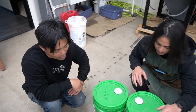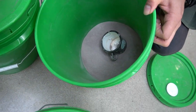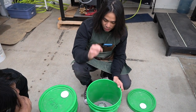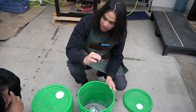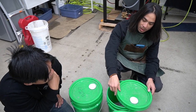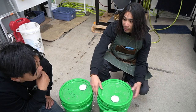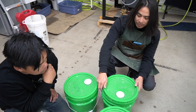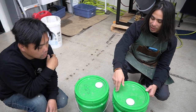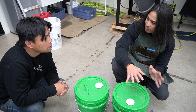What I've got left is aluminum - brown aluminum oxide - and this is the most aggressive stuff I have. The difference between these and this is the shape: these are beads and these are shards. Obviously the material is different - this is glass and this is aluminum. Do you strip chrome off stuff with that? It depends on the integrity of the chrome and the quality - like show chrome. Sometimes I can just mat it. This is the most aggressive stuff where I can strip paint and get it to more of a flat finish.